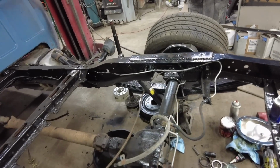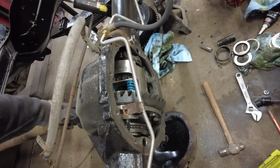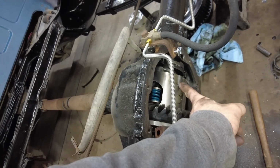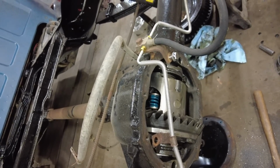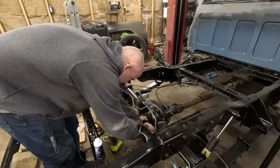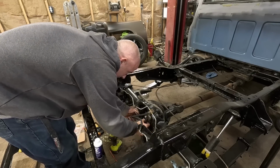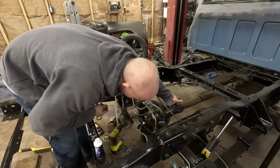Okay. We're going to put the axles in. I don't know if I'm getting this burnout in tonight. It's a school night. Alright, so one of the most important parts of this whole fiasco that I totally forgot here is putting your C-clips in. First, this pin has to come out. And there's a little bolt right there, so we're going to take that out, and then we'll get into the C-clips. My other camera is dying, so I had to switch over. You need an 8. Needs to come out. This pin is what keeps your axles from coming in and letting the C-clips out. So take this out, then we should be able to drop this pin out.